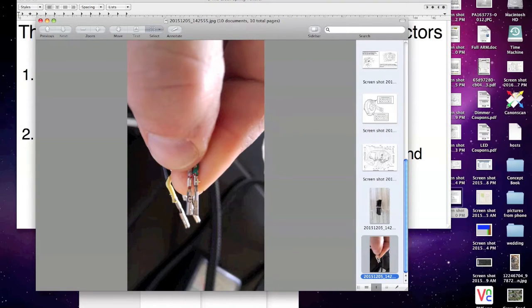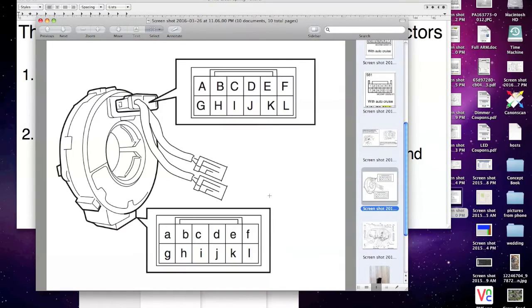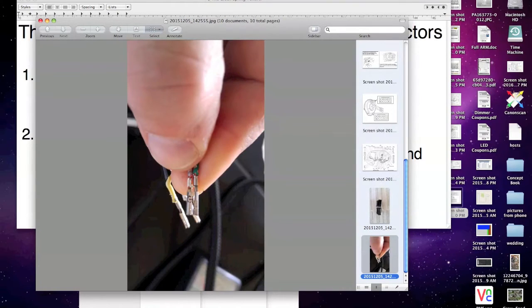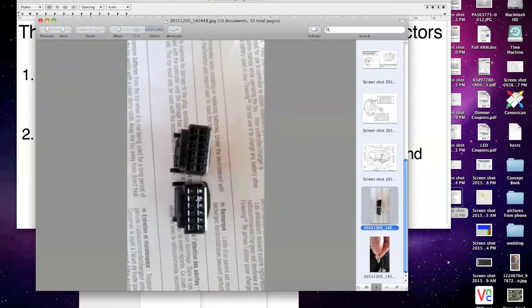So that's, in a nutshell, what you need to get your contact coil. You need these pins from a dump car, and you need to put them into your G346 connector, right, which clicks into here, and you need to run them down to your 383 harness. Okay, so we're just starting on this side. I'm going to show a little clip of what I had to do to deal with that. And if you can get something that'll fit in here into this connector, you need the 4 wires. You need those 4 wires.